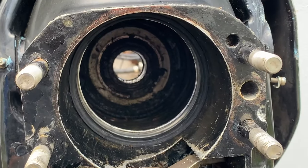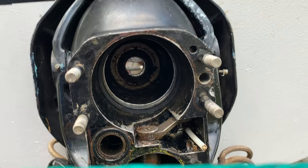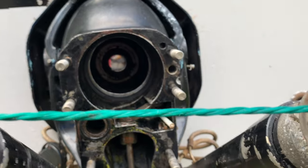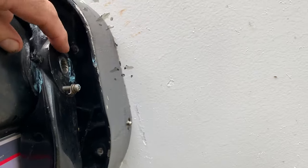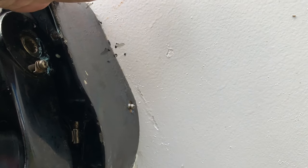We're just gonna align that bearing back there, the retaining ring's in place holding the bellows, and then the O-ring to help watertight it. And then we're gonna put the outdrive on, make sure all our gaskets and everything are in place out here. And we gotta put our trim pucks on here. And also we will use that Zerk fitting right here to grease the bearing inside.